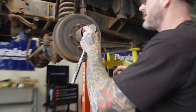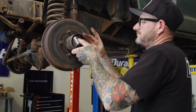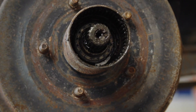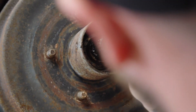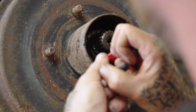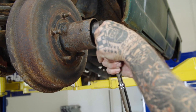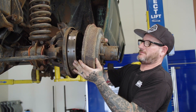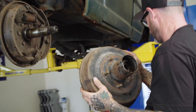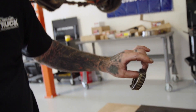I'm going to show you what our next step is. You need to actually get a tool - you can get this at AutoZone. There's going to be two nuts in here; one locks the other one in place. Next step is there's a little locking washer in there and this can be the hardest part of this. I'm sure there's a special tool for it - I don't work on very many 4x4s so I don't have that special tool. Then we've got one more nut in there, same tool. Be careful because there is a seal and a bearing in here - don't let that fall on you. These bearings are in really good shape; we're going to go ahead and just repack them and reinstall them.